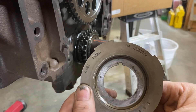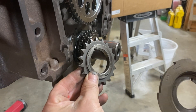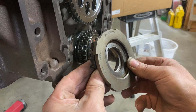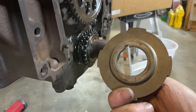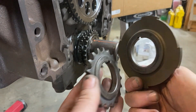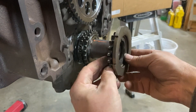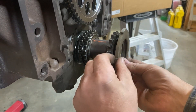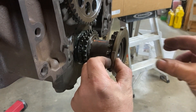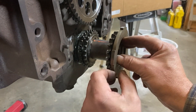It says 'front right' on it. The way this works is the gear goes on first with the timing dot facing forward, and then this goes on top of it. You can tell because you can see where that timing dot was, where these two matched. So you line up the keyways, that goes on like this, and that goes on afterwards. The thickness of that is important because when the harmonic balancer comes on, it touches this and tightens down right against it.